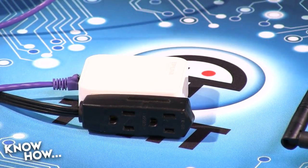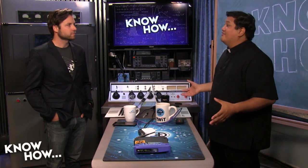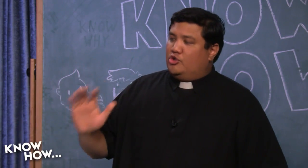Now, I can take this access and put it out to the WAN port of a router, and I can connect as many devices to that router as possible because to the apartment building, it only sees one. Right? That makes sense. Perfect. Yeah, that's exactly what you want. Super cheap way to do it.